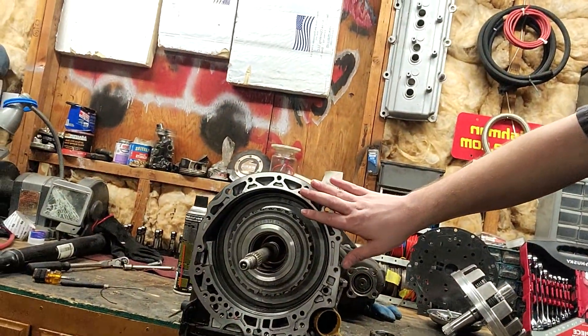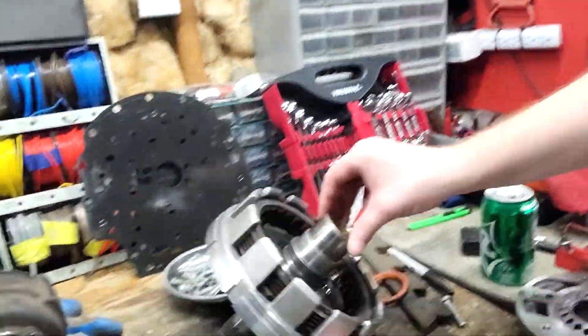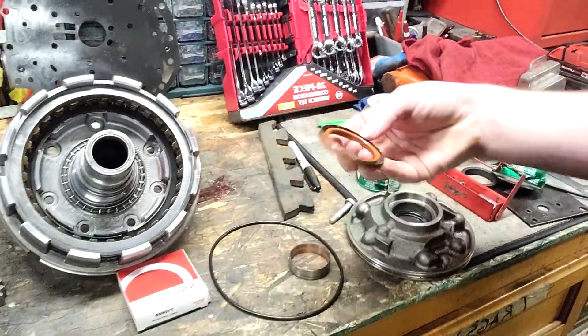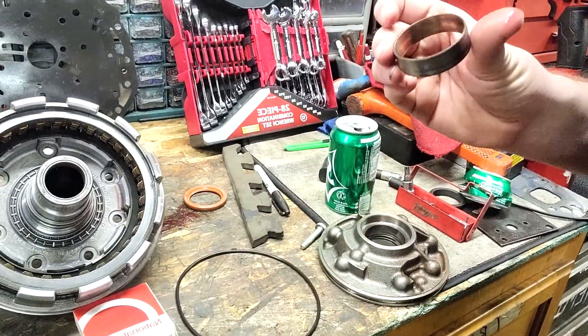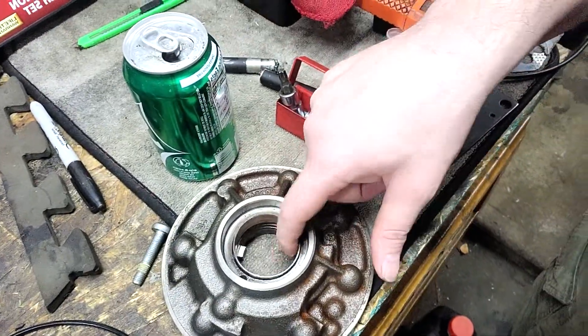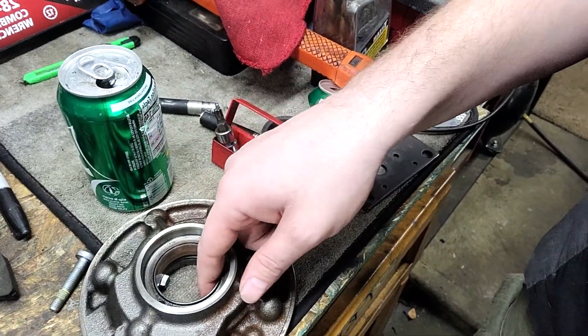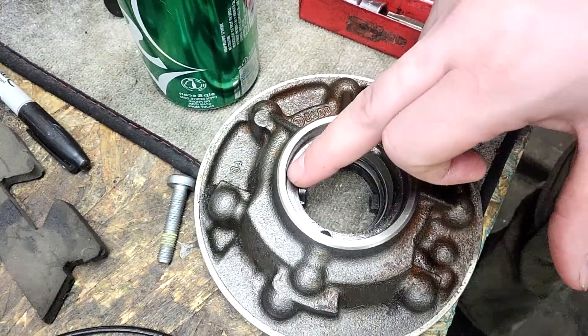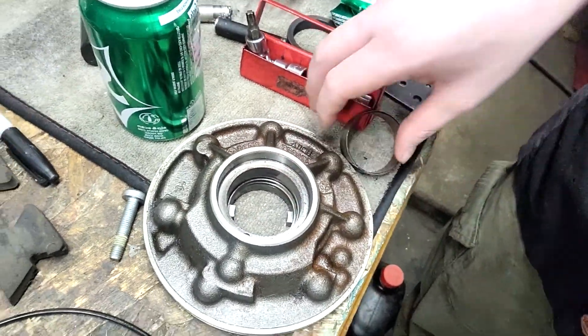It's actually the next day. I ran into a snag and should have showed it right away but I started making calls trying to figure out the solution. The bell housing is off and the front planetary is out. After pulling the front seal, I noticed a bearing — or bushing — that is supposed to sit down in here but it's wiggling around, it's loose. There's also a gap at the bottom where it popped out, wore a new groove, and you can see signs of heat stress around there. So the problem is we pretty much need a new pump.